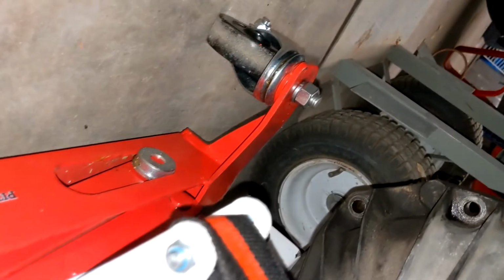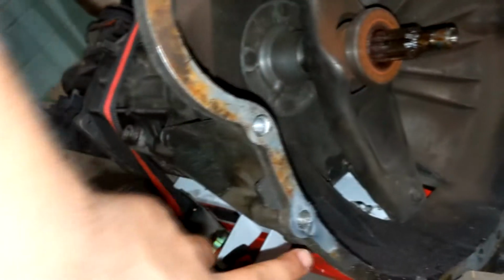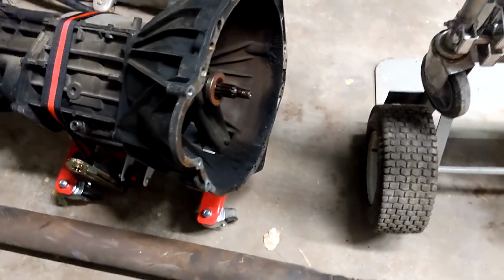Point being, I had to go on with the extensions, lay on the back, try for a long time to match the extension up with the socket, and when I got it, I yanked that thing over, and then I got those 2 bolts out. Getting those 2 bolts out took nearly an hour and 45 minutes, but I did it. Also, when it comes to taking out the bolt on the passenger side, make sure that harness plug is disconnected, because if the harness is not removed from the top of the transmission, you will not be able to see the bolt or get the socket on it.